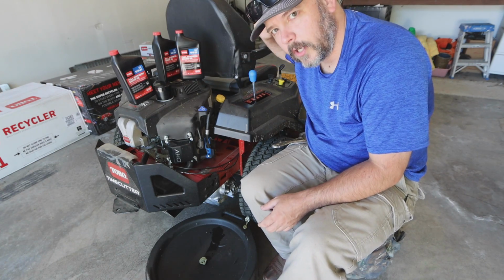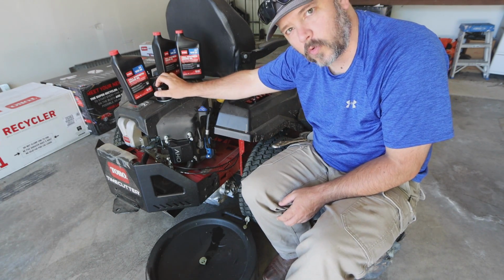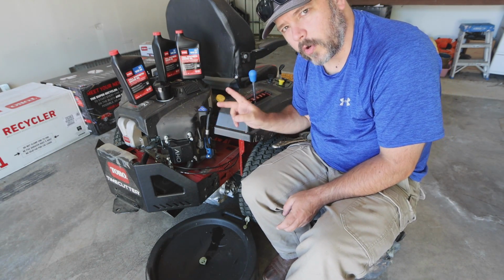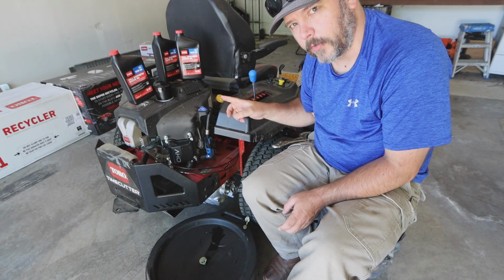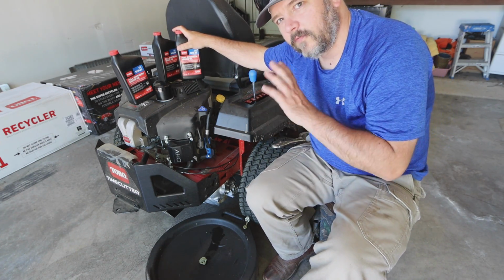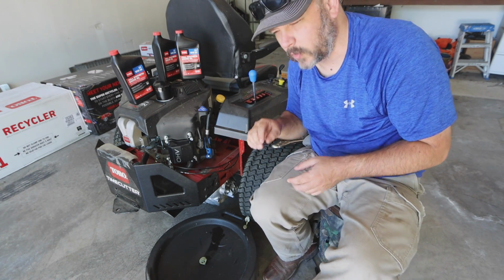You have your oil filter, 3 quarts of oil for your first oil change, if you're changing your oil filter, which you should be every time. 2 1/4 quarts will go into your motor, and then you will have 3/4 of a quart left over for your next 3 oil changes. So every oil change after this, you just buy 2 quarts.